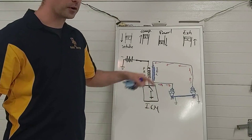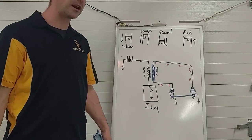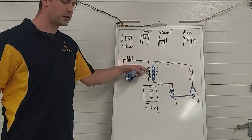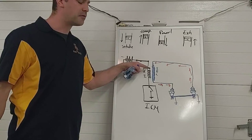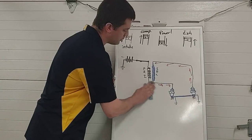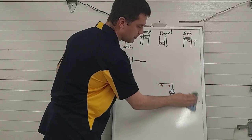If you have an engine with an even number of cylinders — a four-cylinder, a six, an eight — this type of ignition system can be employed and we can get rid of a distributor fairly cheaply. For a four-cylinder engine you need two coils, for a six-cylinder you need three, and for an eight-cylinder you need four. This requires a slightly more intelligent ignition control module that can run multiple coils, but not a lot of computing power or expensive coils.